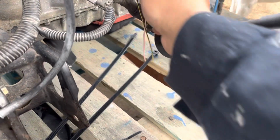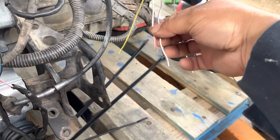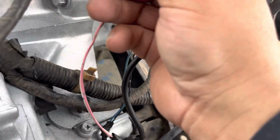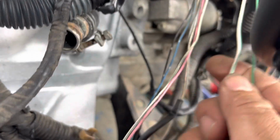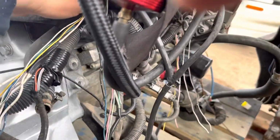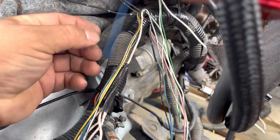And then you have a colored wire, right? And the gauge is different as well. See, these two are the same, and the other two are down here. So now you have a green wire and then a solid, larger diameter white wire with the green stripe. Same thing on the blue. So there you go. The resistor goes on the colored wire on all 4 injectors.